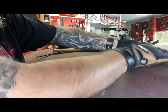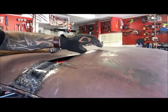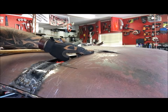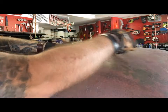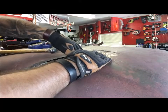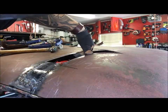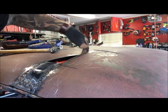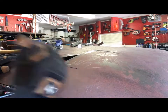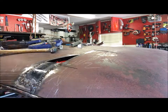What I'll do now is start setting up my next piece. This one I can already see is going to be an issue. I had to cut this relief, and I'm going to have to bring it down a good amount. I'll probably have to put a pie cut in here and bring the next one down, and try to take some of this out. Meanwhile, the back is being a pain in the ass too. So I'm hoping I can lift that up and get that panel in there. That's why I'm using the angle on the clamps to kind of get me close, so I can take and work the piece in.